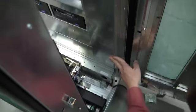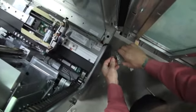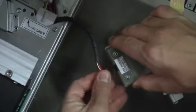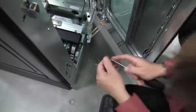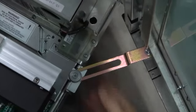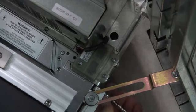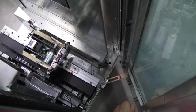Once we go ahead and finish the cover up, the last piece is to move the hinge on the door to the bottom and reconnect the door interlock power. Once we have that in place, we can go ahead and tighten the three screws. When you push or pull this, the door is going to close, so we need to kind of wedge ourselves in there. And that concludes our replacement of the power backplane.